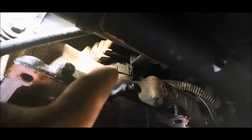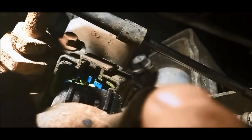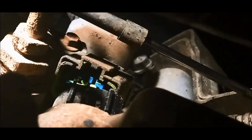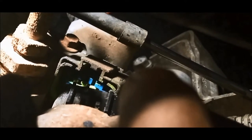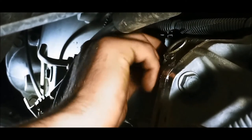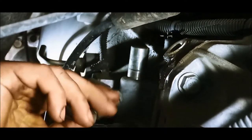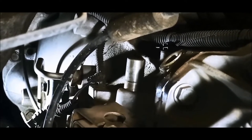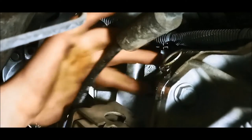This plug is on the left hand side of the transmission — you've got to pull that one out as well. That's the range sensor there. And now the 13mm bolt right on that angle is like a dog leg linkage on the top of the selector shaft. 13mm bolt you've got to loosen that and slide that linkage off. When you're doing the job you'll see there's not a lot of room. Sometimes you'll find that shaft is a bit rusted or damaged — you need to clean that to be able to easily pull it back through the case.